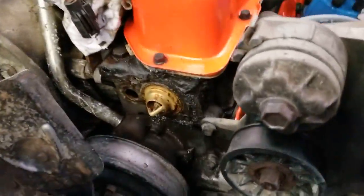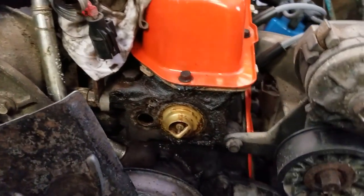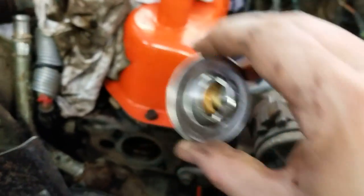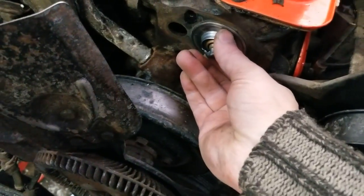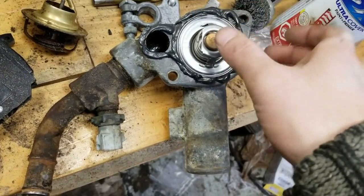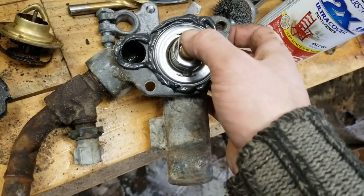I took a piece off the front to replace the thermostat, which is right there. It's very crusty, and while that's still in place I'm going to clean around it. That's the new part all cleaned up, with my custom gasket, and that's the engine part all cleaned up including the new thermostat. So that springy thing in the back is always towards the engine head — I'll put it right in the gasket. There we go — that might even hold it in place. There, perfect.